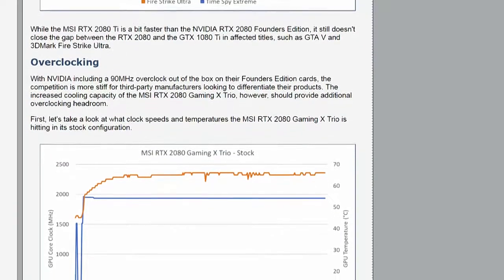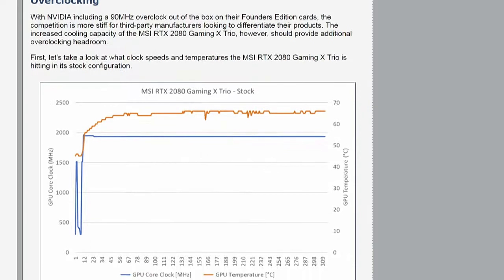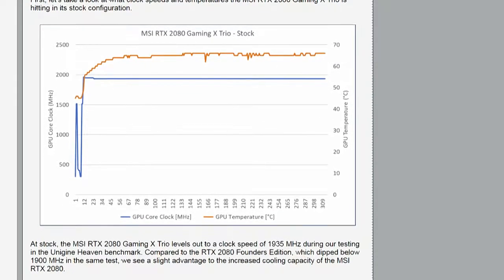Until people find ways around NVIDIA's voltage regulation, you're probably going to see peak overclocking settings relatively close amongst competing products. The difference is you'll get much lower temperatures. This MSI card at its manually overclocked settings — a 110 MHz GPU offset — settled at sustained clock speeds of 2025 MHz, running at around 71 degrees Celsius, which is a good 9–10 degrees Celsius lower than the Founders Edition. So that's a positive. But in terms of overclocking, you're about in the same realm as the Founders Edition.